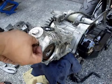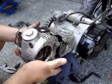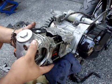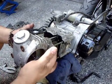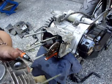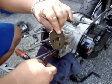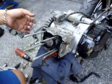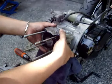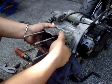These are long bolts because these are connected to the crankshaft. After loosening the head nuts, when you slide it all off, you can see that your timing chain and the timing gear come off here, and so it's easier to pry them. After which, take off the gear first, and then after taking off the timing gear, you should slide the block out from the crankcase.